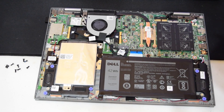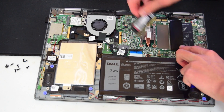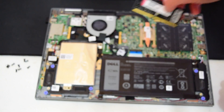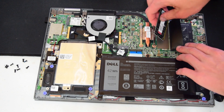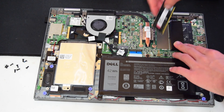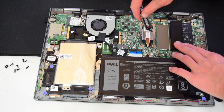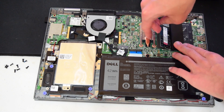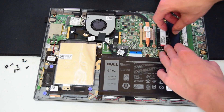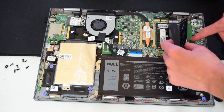To replace the RAM is pretty simple. I had already upgraded this since I filmed before, but I'll re-show y'all how to do this. Basically, you just line the notch up — right in here — and as you can see, it lines up with this black little notch right here. If you flip it around, the notch does not line up. So you flip it around, stick it in, push down, and the two little clamps on each side will clamp down. This supports up to 32 gigs of RAM — there are two RAM slots and you can put 16 gigs in each side.